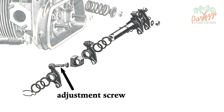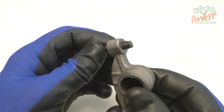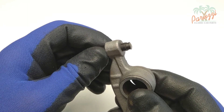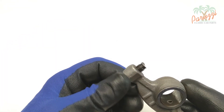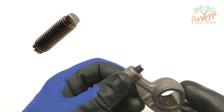The adjustment screw is also subject to wear. By tightening the adjusting nut too much, the adjusting screw can stretch, in which case replacement is the only option. Misalignment of the adjustment screw relative to the valve stem can cause excessive wear on the rounded side of the screw. This adjustment screw is very damaged, which will seriously affect the adjustment of the valve clearance. Replacing the adjustment screw is obviously the only option in this case.